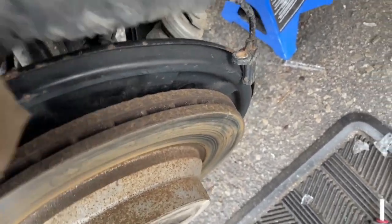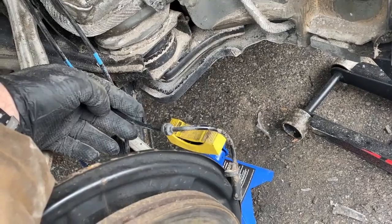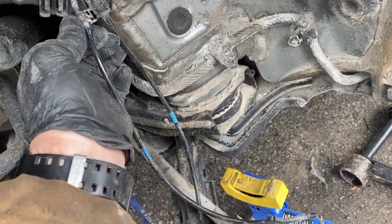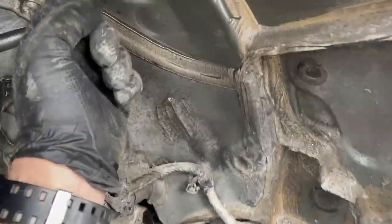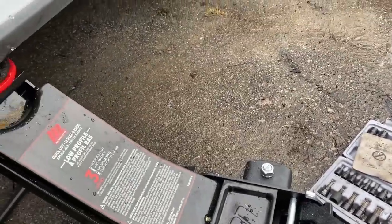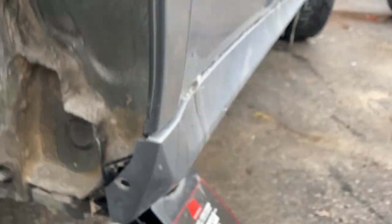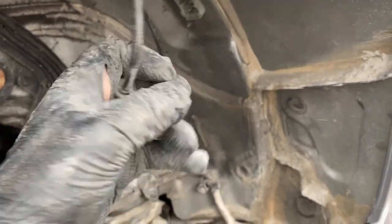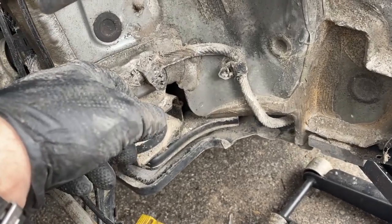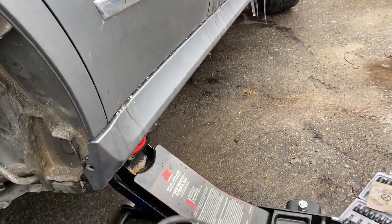The E11 torx bolt is out — that holds the sensor and the little hold-down plate. You can unclip it from the hold-down plate, follow it up, and there are little rubber grommets that pop into slots. The outer connector: there's a little metal bar pin — push that bar in and pull the clips out toward you. They're sistered together — just pull them apart, then take the rubber connectors out of the plastic. Let's go grab the new one.